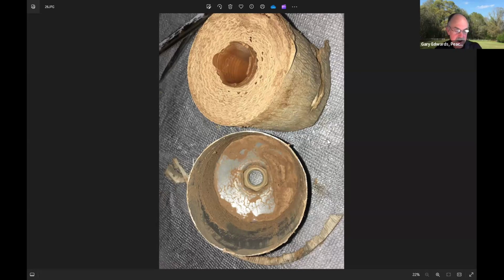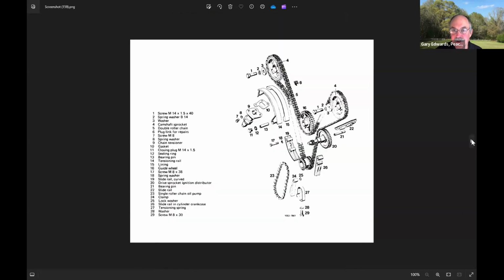So, bottom line of the major content here is that if you have one of these cars, pay attention to the cam oilers, pay attention to the upper chain guides, and pay attention to this thing we call chain stretch. I have read that 150,000 miles is probably about when the timing chain ought to be replaced, but go look at the car and see how much chain stretch you have, and base your decision on that. My car was showing 63,000 miles. I think it had really been neglected for a long time. I'm not sure the oil changes were done at an appropriate time, and any of those can shorten the life of the timing chain. But those 3 things really matter.